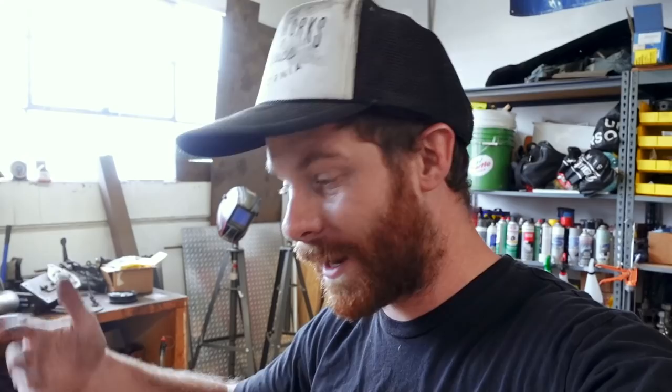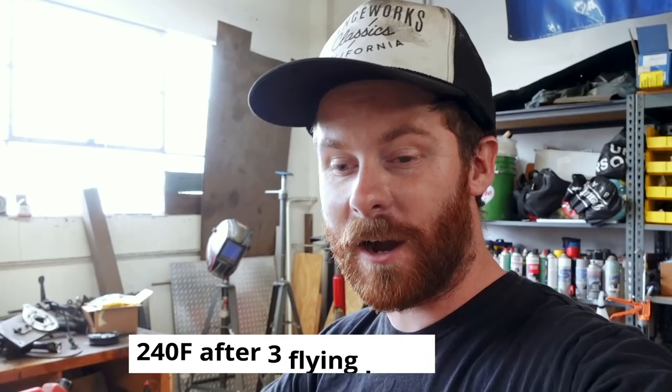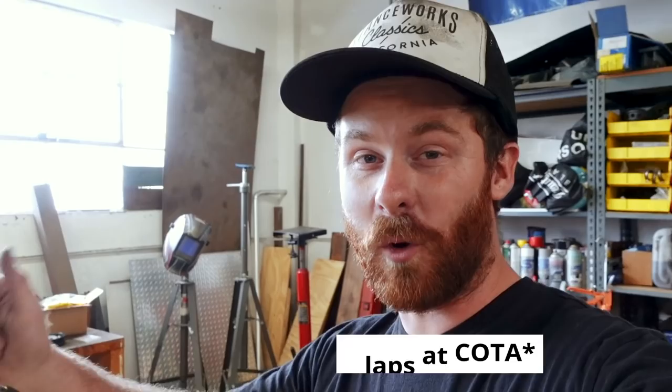All right, oil cooler — I know at this point we've had two full episodes on it, I'm only going to talk about it for a quick second. We're throwing out all the progress — all the discussions about how to duct this thing, how to plumb it — all that stuff. We're not even going to run an oil cooler. My buddy Amir, who has a turbo K20 NSX and competes in Global Time Attack, called me up after watching the last episode and asked why run it at all. According to all his data logs, the highest his oil temp has ever gotten in his car is 240 degrees, and I've also got two to three times the amount of oil capacity he does. So I'm going to eliminate a point of failure and a lot of weight. We will have all the data logging we need with the Haltech ECU, and if we see oil temps getting hotter than we want we can always add it back. Oil cooler — hasta la vista.